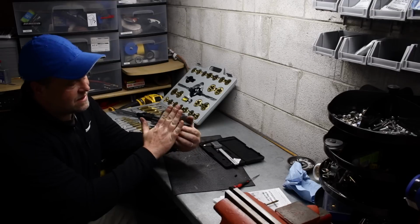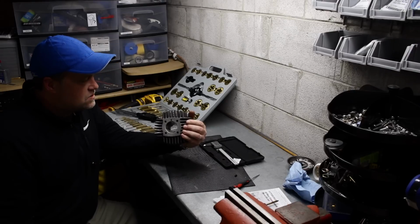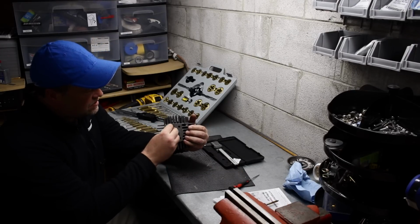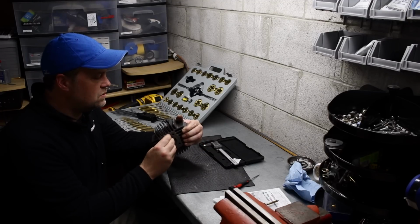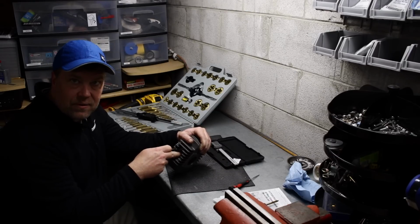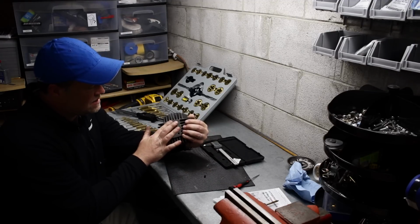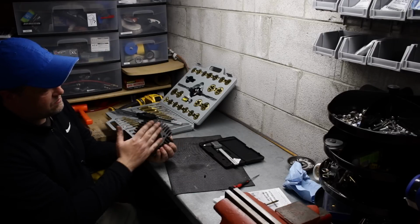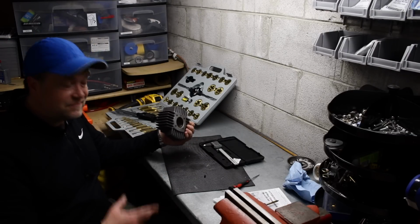I thought I had a gasket that blocked it, but it's not doing a very good job of it. So I bought these little set screws, and I think I'm gonna tap this hole out and set maybe two of these set screws in there, and then epoxy it up with some high temp metal epoxy, and then I'll sand it flat so that it's totally invisible and gone.